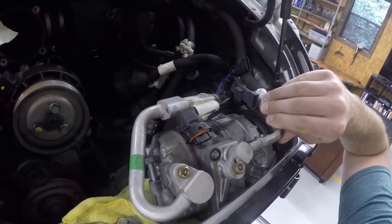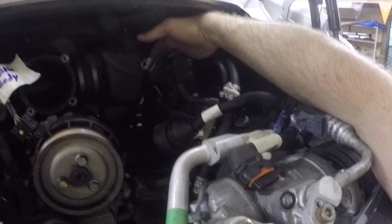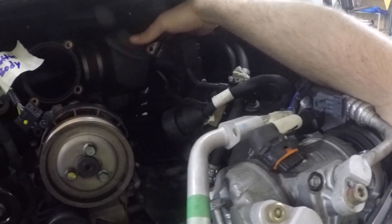On the engine side, as far as taking it apart, there was really only one piece that was very annoying and I couldn't find a lot of information about people having problems with it — the back bolt on the air conditioning unit. It's basically back behind the intake, behind this first intake runner. You have to stick an extension down in between there and weave it to get to it. That took about half an hour. Everything else went really smoothly and was torqued properly from when they had put it together last time, so no real surprises — everything's in great shape.